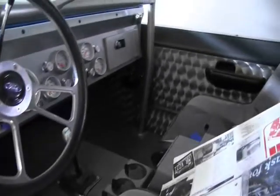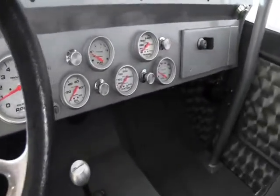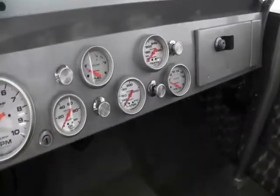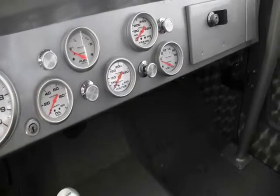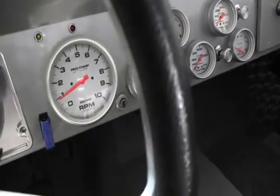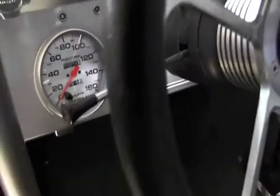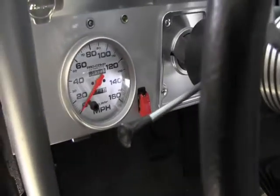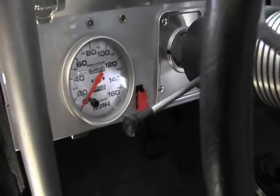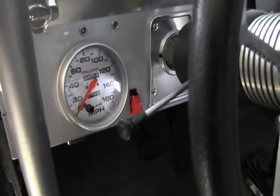I've also got it on the inside of the rest of the truck, as you can see, and also on my dash putting in all these gauges right here. This was a flat panel dash, so there was nothing here. I ended up cutting the holes out with the plasma, and I was able to mount my gauges — came in really handy for this very large tach and the also very large AutoMeter speedometer. These are pretty good size five-inch gauges, and to find a hole saw five or six inches is pretty difficult, so the plasma came in extremely handy for that.